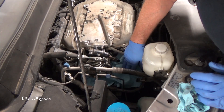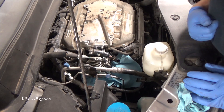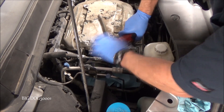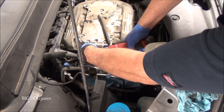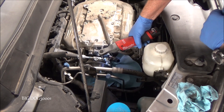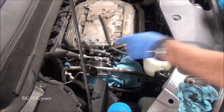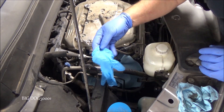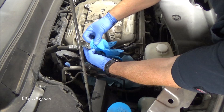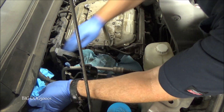I put some rags down just in case we spill any more fluid. Now we'll go ahead and pull these two bolts off so we can get this high pressure hose off of our power steering pump. I just have a 10 millimeter socket on the electric ratchet. I'll just pop these free and spin them out. They're both the same length so you can't mix them up. Now we'll just pop it up out of there — I'll use a sacrificial Harbor Freight glove so we don't make too big of a mess. There we go. Now we can just put that up out of our way.